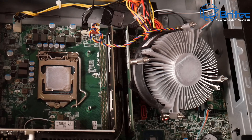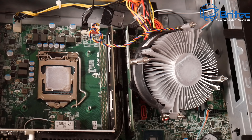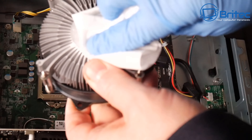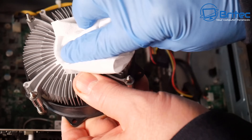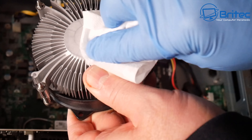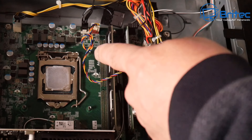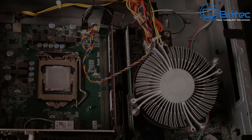Is it going to harm your PC? It'll probably give you a few degrees more temperature than normal, but you have got some compound on there that will fill in the imperfections of the heat spreader — the little pits inside the metal. The compound is just to fill those in, make sure the two metal surfaces aren't touching each other, and just add a little barrier between the two. I'm going to clean this off and try another method to see what the difference is in temperatures.